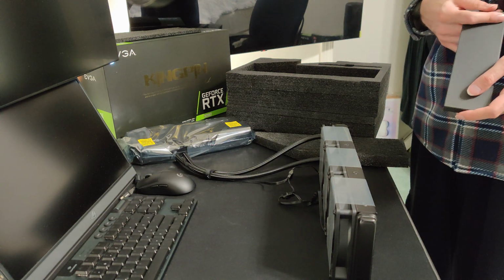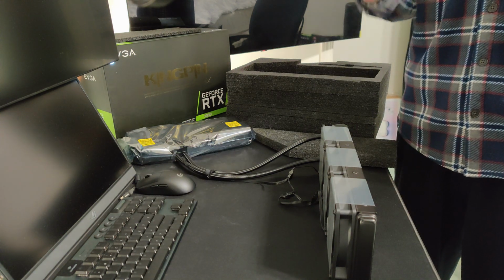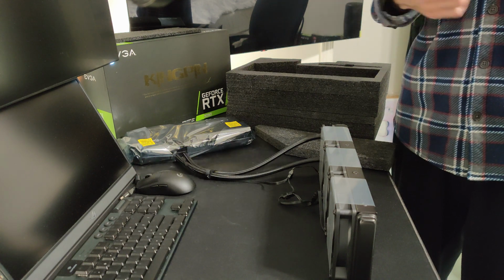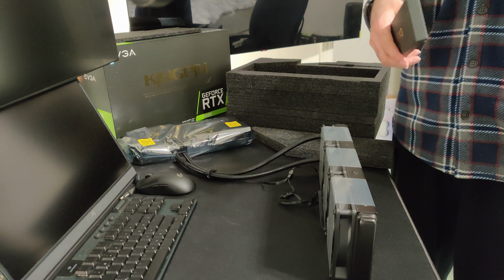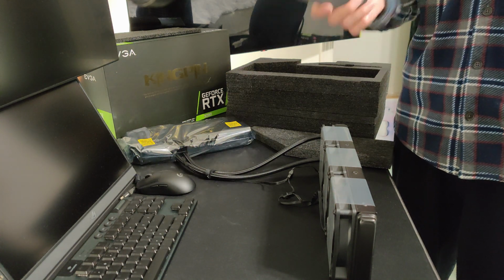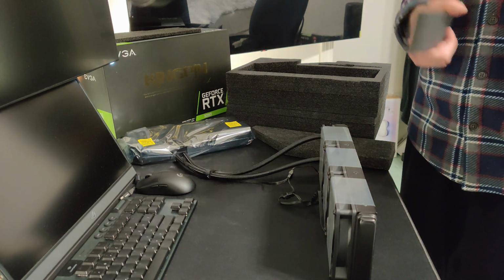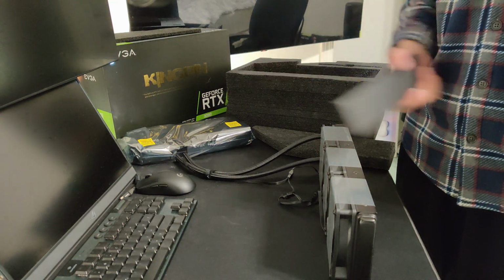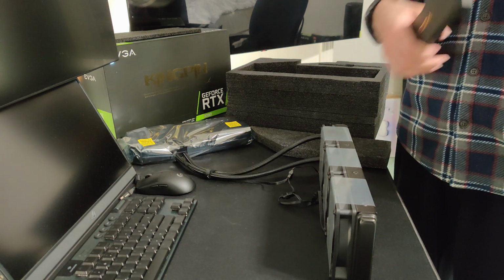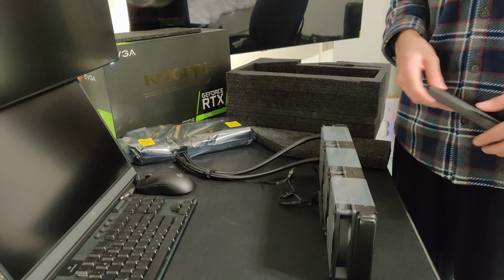Definitely something funky there. The main reason that I hate undervolting is every single time I have MSI Afterburner apply these settings at startup, it will not register. I have to literally go in manually every time I boot up my computer, select my undervolt profile and hit check to apply it, every time I boot or reboot my PC. I have no issues at all when using the overclock profile for any of the graphics cards I've had over the past like 3 years. My PC will boot and it will apply the overclock profile, but the undervolt does not apply. Honestly, it's just not worth it.